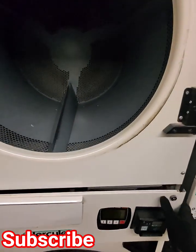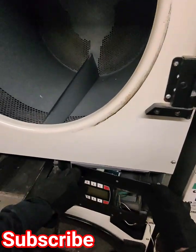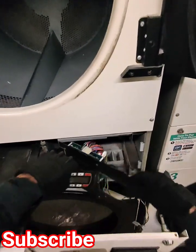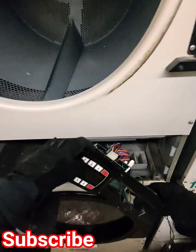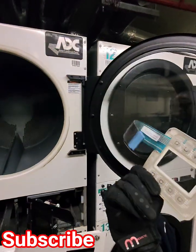So I'm gonna just show you guys real quick. You take off the front panel, and the touchpad is stuck on. It just sticks on, and you unplug it from the back. You feed it through the little slot right here. It's that simple. That's the touchpad.